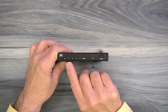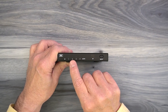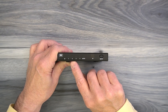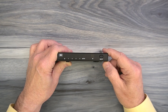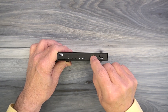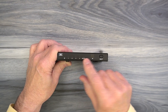These first four LEDs indicate which of the inputs is currently being sent to the monitor, and you can select which input you'd like to see by tapping the input button to walk from one to two to three to four to auto. When you put it in auto mode, it automatically selects the input that was last used and sends the output of that to the monitor. To the right of that is an infrared receiver used with the included remote control — when you position the unit on your desk or media center, make sure that window is visible if you're using the remote control, because that's where the signals are picked up. To the right of that is the input selector button; you can tap that to move between these four inputs.